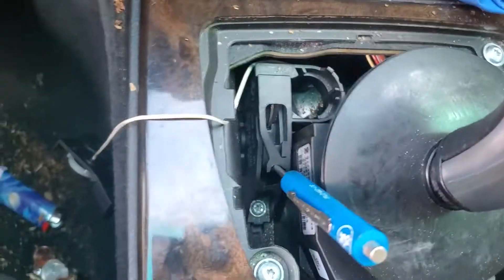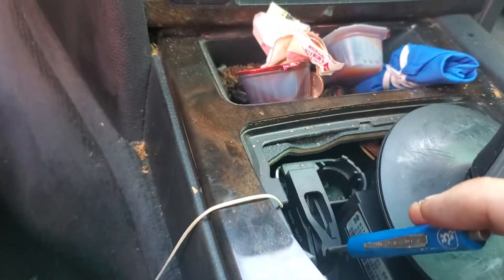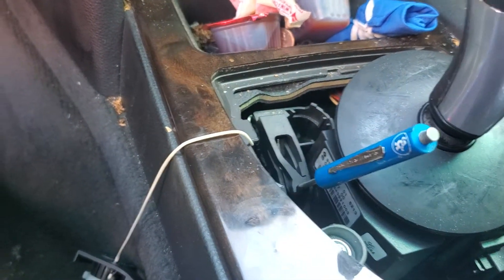You've got to pull back pretty hard, and you're in neutral. To get it out, you just pull down on this and then push out on that. You need two hands to do that. But that'll get you in neutral so you can tow it.